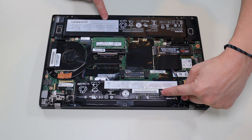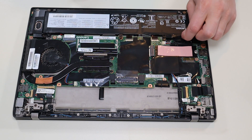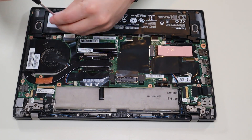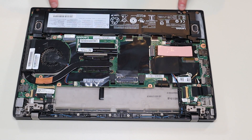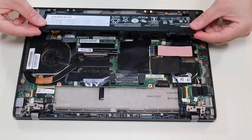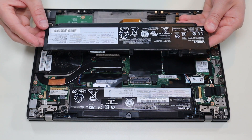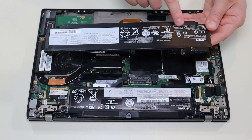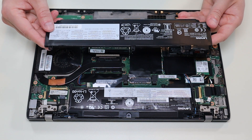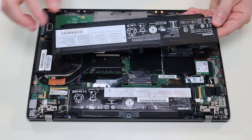In this computer we have two batteries. The main computer battery screws in there and there, and plugs into the motherboard right here underneath this tape. So I'm going to go ahead and take out those screws. It's also held down underneath these two clips, so I'm going to pop this up out of that port and then slide it out from under those two clips — and there's your battery. If you wanted the battery specs, I will have them below in the description. This is a Lenovo brand name battery, 11.4 volt, 24 watt hour. I will have the part number and those specs below in the description, and I'll also have a replacement battery included in that link below with all the replacement parts.